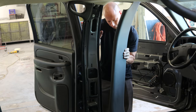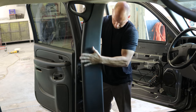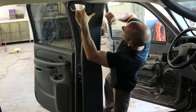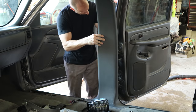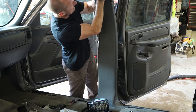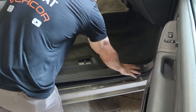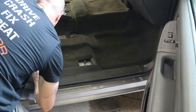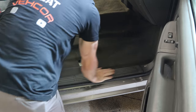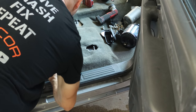We're going to pick up where we left off last time, putting our interior back together and put this B-pillar trim in there. We get to use both of our installation tools. We'll put the one on the passenger side. Now we can put our sill plate in — it just clips into the metal bracket that also routes the wiring harness. You can put these in before the seats or after; it doesn't really matter. Put the rear sill plate in again with the sill plate installation tool.